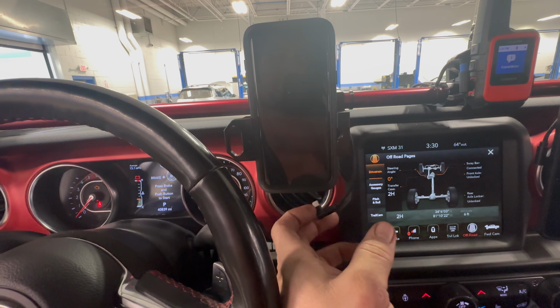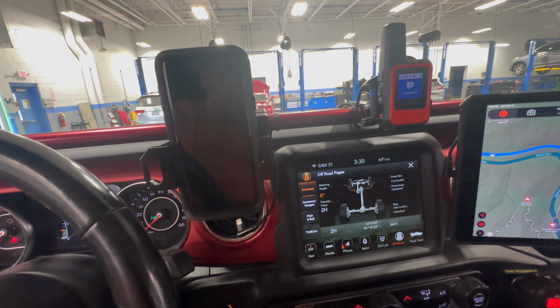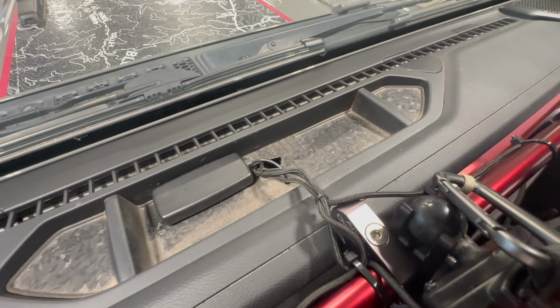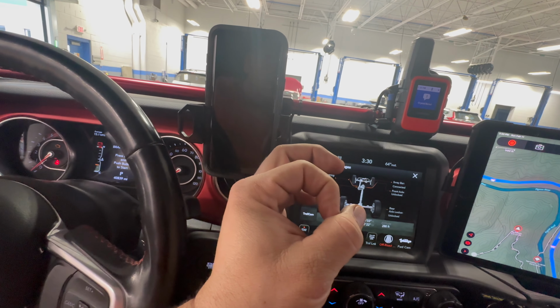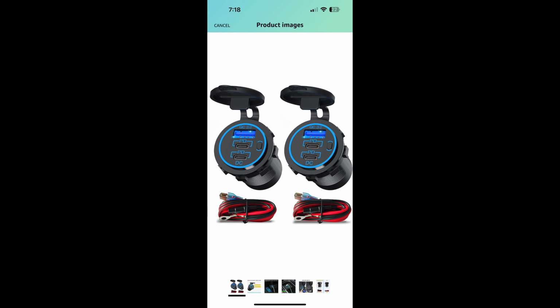We have a power cable for it here, we have a power cable for this, and we have a power cable for this. All USB 3.0, and the wires run down under here. You pull the display out, and then I wired in one of those. I'll put a link in the description below on Amazon. If you do hardwire this on at all times, like I did, if you ever have to jumpstart or replace your battery, you have to pull the display back out and press the power on button again on this switch on here. If you do hard mount it originally on top, the LED backlight of this switch creates a huge glare at night.